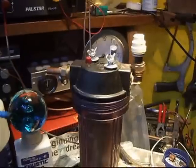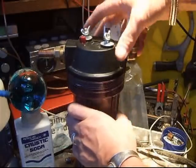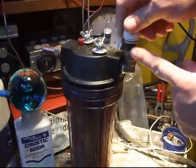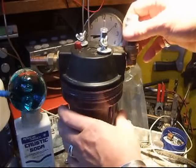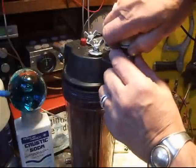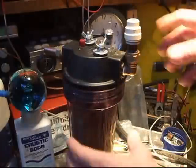If you're using wet cells, these are the things to use — absolutely brilliant. You can get them in most places, just do your research online and shop around. Normal plumbing fittings fit in there. There's an elbow that just fits into the side — that's already threaded on the side of your water filter housing. I've just put a 15mm elbow on there with a piece of 15mm copper and a push-fit cap there so you can fill your cell.